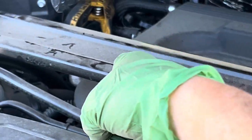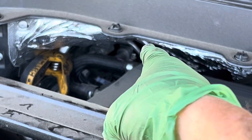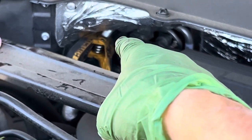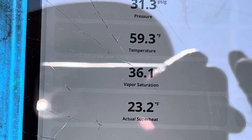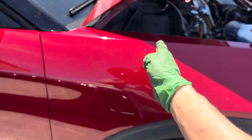I'm a couple of inches up from the T — that is the rear line coming up, over, dropping down right there, and I'm connected right there. Let's see what superheat we've picked up. Focus... superheat is 23 degrees. So here at this point near the front of the vehicle, we are at 23 degrees superheat.